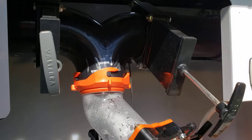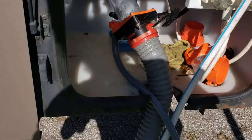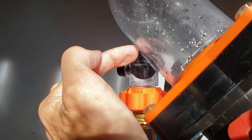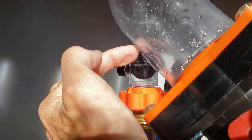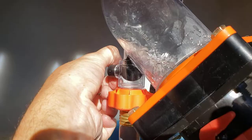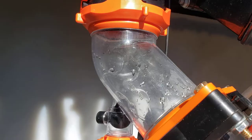To create a back flush you've got to do this in the right sequence, because you don't want to apply pressure without the water having somewhere to go. First, turn on the water. The water pressure is on the hose, which comes up to this little valve. When you open up this valve to let the water flow, this device has a little duckbill valve in there — water only flows one way. You probably don't want to use your fresh drinking water for this process either. Open it up and the water sprays through. Make sure your gray valve is closed and this valve is closed, so the only way the water can go is up through the black tank.